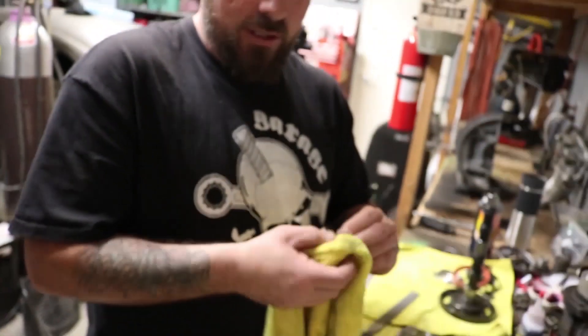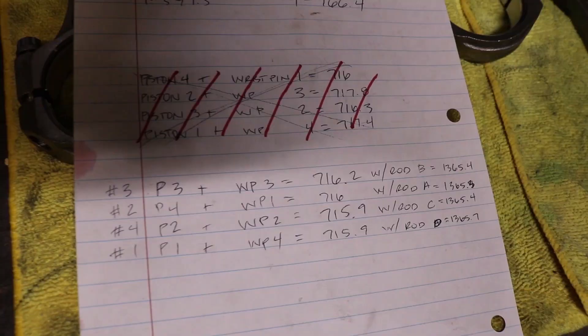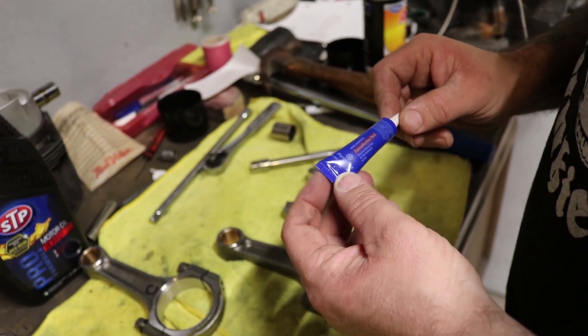I don't know how people afford to pay people to build their engines for them. I'm doing it myself and it's ungodly expensive. I have the rods lettered and I have the pistons numbered because I have weighed them all and balanced them all to within like 0.1 or 0.05 grams. They're still a little bit off, so I tried to balance them further by putting lighter rods with slightly heavier pistons. I have them marked out on a piece of paper where I'm putting them in relation to each other so that they have the best balance as they go back and forth. I'm putting loctite on the threads of the bolts because it's going to be assembled permanently.